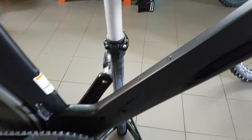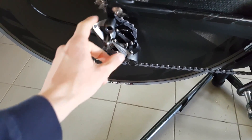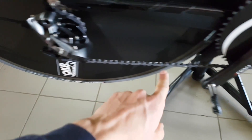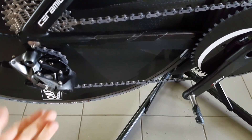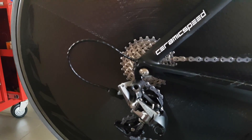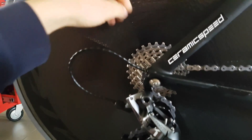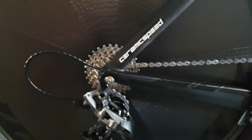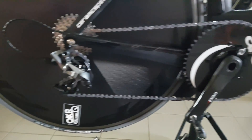I've removed the bottle cage, so the bike is now race ready. One observation from the Force One derailleur: this chain is longer than the one I had on for training — to reduce friction, to have it as long as possible. I think this is an uncut 116-link Shimano chain. But if your chain tension is lower than before, then you have to add some B-screw adjustment, otherwise the derailleur won't like to shift on your biggest cog — even if there's enough clearance. That's one thing I've noticed.